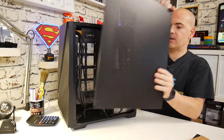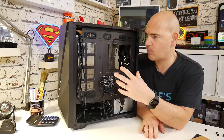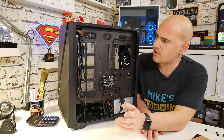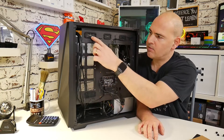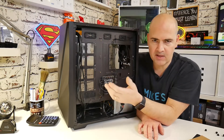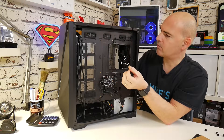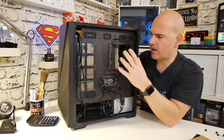This does actually give you pretty good access inside. Straight away, as you can see in the back here, we've got tons of room — at least an inch or so of room for cable management. I've also noticed there's quite a few rubber grommets; potentially for some people they may be in some of the wrong places, but it's nice to see them included regardless. Starting at the top, we've got our wiring channel for the front panel connectors and the RGB section. Moving along the top, we've got three rubber grommets here, so if you plan on water cooling in this top section, this is going to give you easy pass-through for cables and cable management. There's an additional grommet at the end, which is going to be in perfect position for your ATX power connectors and supplemental CPU power. This top section has been really thought out extremely well.